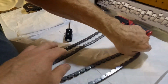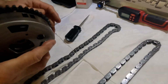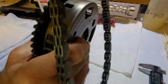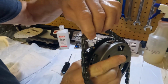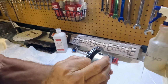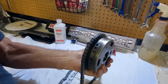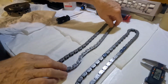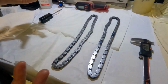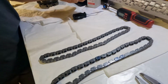That this is wider. Well, I know this has overall been a pretty good chain. I've not had any issues with that. But yeah, you have the space here for the wider chain. And you know the distance in the links. I get it on there. I mean it fits on perfectly, and this width here doesn't touch anything. It's just beefier. The measurements were more consistent too. This is plus or minus on the thickness of these, like 3 or 4 thousandths, or maybe 5 even. This was plus or minus 1 or 2 thousandths, which, if I were designing the chain, is kind of what I would be shooting for.